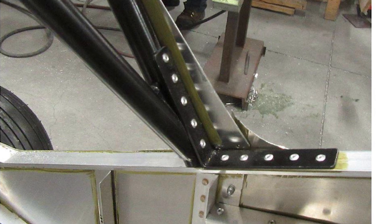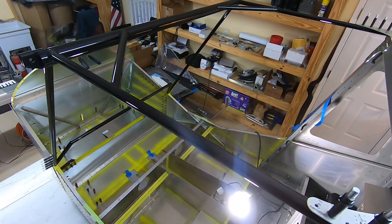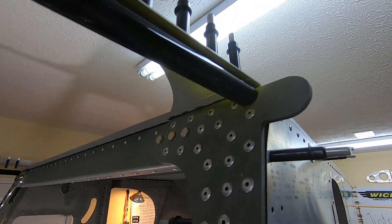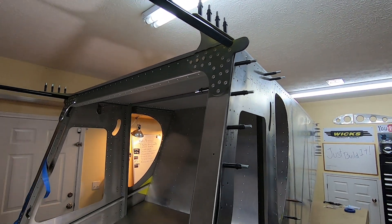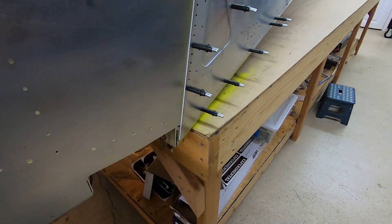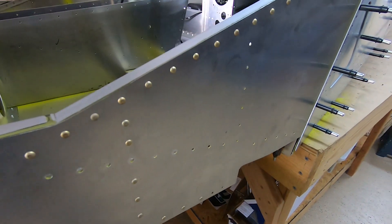Once all the holes are drilled, I'll remove the cabin frame, deburr it, and clean it all out. This is a steel tube frame, chrome-moly, and what I'd like to do is get some paint, hold this thing upside down, and pour paint directly into the tube - let it fill the tube up completely, then flip it over and drain the paint out. That way I've got some great corrosion protection on the inside of the tubing. I know it'll probably be years and years for that type of corrosion to have any effect, but I'm in Florida, very humid environment, and I want this thing to last forever if possible.